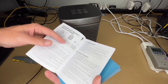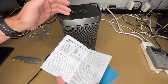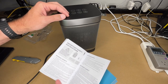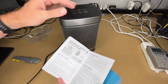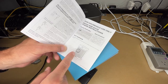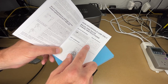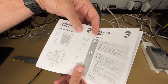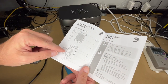There's a manual with a couple pages of safety information — you do want to read through all of this. Modern electric heaters tend to be very safe if you follow the instructions. When they cause fires, it's typically because someone is overloading a circuit, throwing clothes on top, or putting it behind a curtain. The manual notes the front surface gets very hot, rated power is 1500 watts, and the remote uses a CR2025 battery.